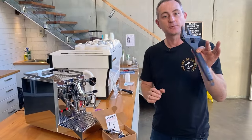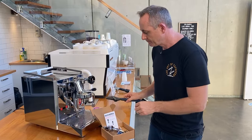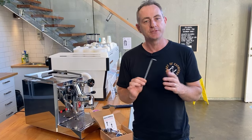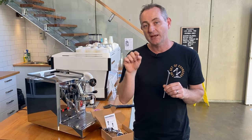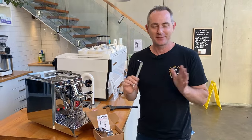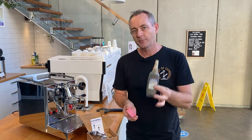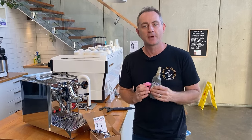You're going to need a couple of tools. We'll use a large adjustable spanner to undo the top mushroom and the bottom exhaust. We'll also need a number five allen key to undo this little hex head bolt in the front. If you open this up and it isn't drilled all the way through, you may need to drill a pilot hole. I'd also highly recommend liquid Loctite — you could use thread tape, but Loctite is definitely the best option to do this job safely.